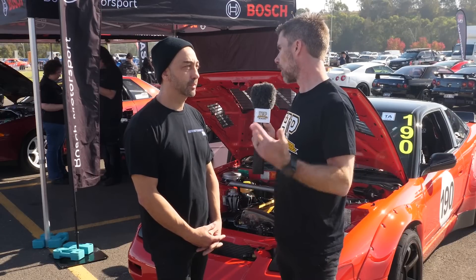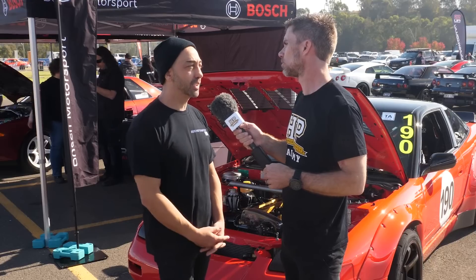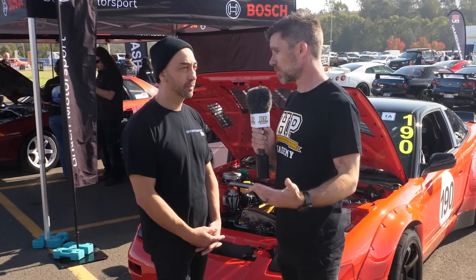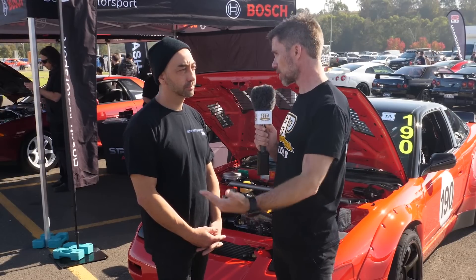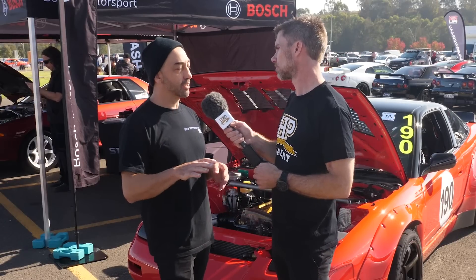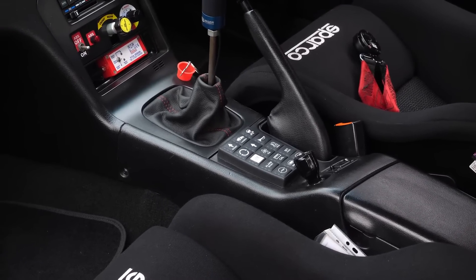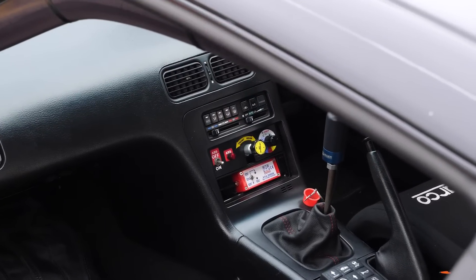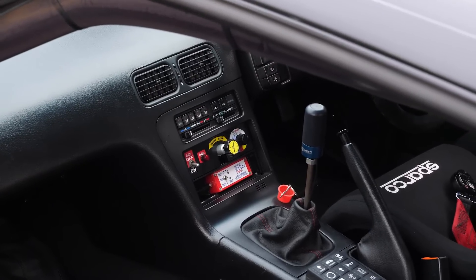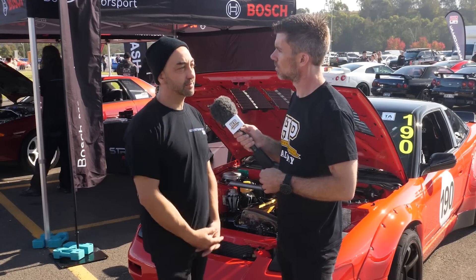Of course this requires a conversion to drive-by-wire throttle, something the 180SX never came out with. That's right — the drive-by-wire helps me a lot, even on take off, and really controls the whole car. Another element you can do with drive-by-wire, which is much more difficult with a cable throttle, is map the relationship between the driver's pedal position to the actual throttle opening at the engine. We've got an extra three buttons on the keypad where we can have 65% throttle opening. If I'm full throttle it'll still only give me 65%; hit another button and it takes us to 85%; and if we're feeling good and in control, put it to 100%. Not only boost per gear but throttle position opening — it really helps you drive this car.